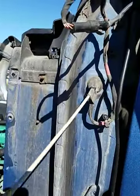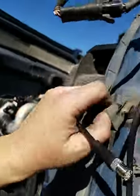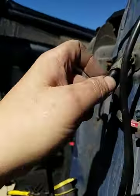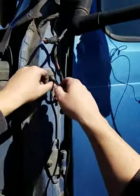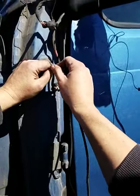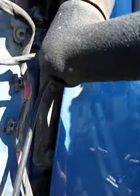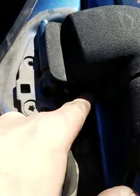Going to pull the old one through the door. And we'll come by here, grab the new one. Okay, so now that's through. I'll grab it from inside the firewall. This piece here, I'm going to tuck back up inside here a little bit. This curve's going to go up and wrap around in here along with the coax. There's a little notch designed for it.